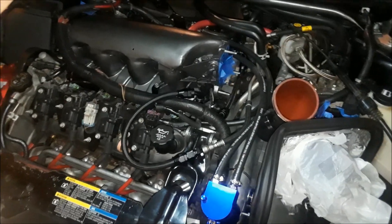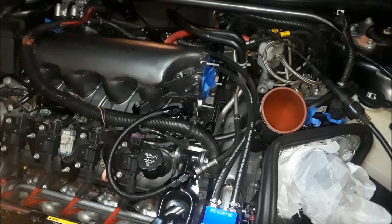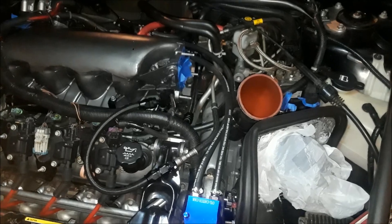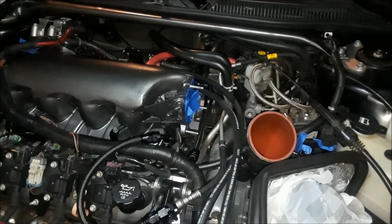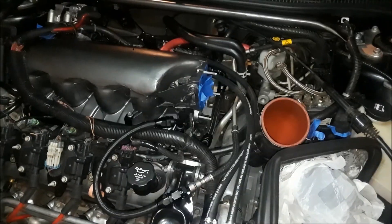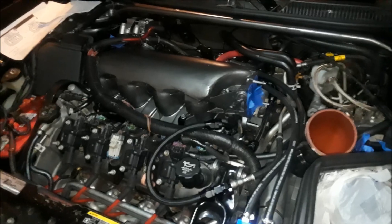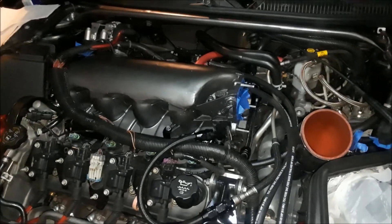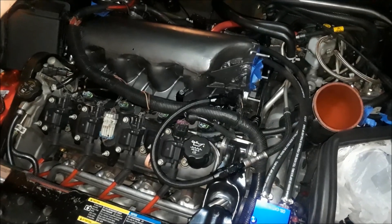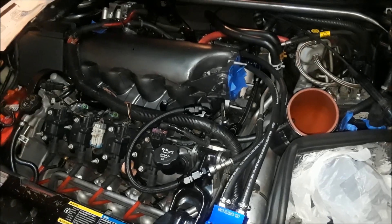Here's the update — I know what you're thinking. Didn't you have the intake in and all that? Well, I did and we tried to fire it up, and the LQ4 throttle body just — for whatever reason — won't work on this car. I know you truck guys have these throttle body position sensor issues, throttle body actuator and throttle body pedal sensor problems. What I went ahead and did: I ordered an LS3 throttle body, AC Delco, and I'm going with that. That's probably going to be the best option and hopefully it won't give me any problems.